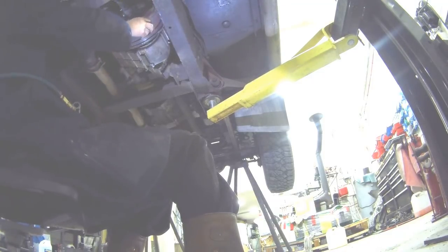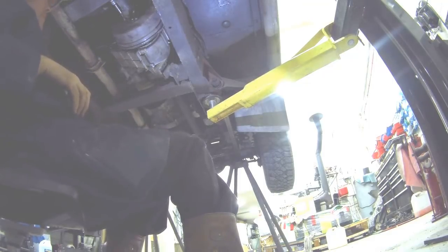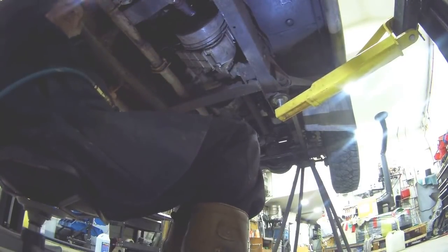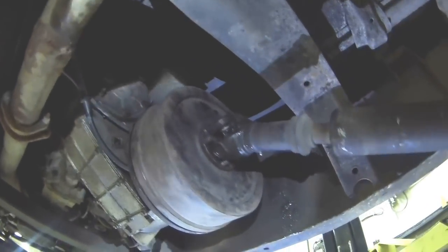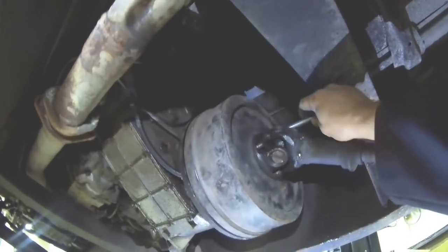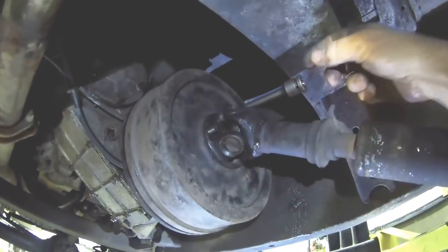There's only certain positions that you can get in with your tool like this. You just turn it round. Sometimes, supporting the prop shaft, you have to let it go a little bit to get into some of the nuts. You can see the angle of the prop shaft now is a lot wider so you can get better access. And the problem is there isn't much room here to get your spanner on, so what you do is just turn it around a little bit and then you can get in — and then you can get your gun in and whiz that nut off.